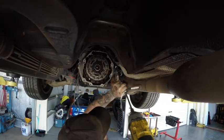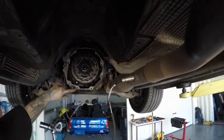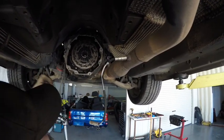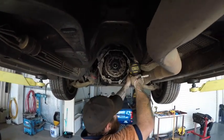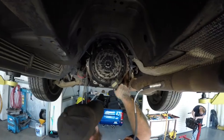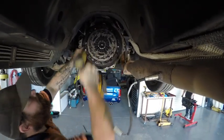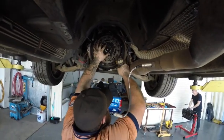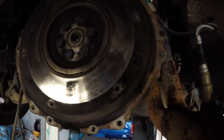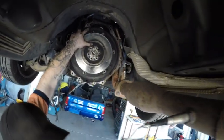We'll give this a clean and unbox the clutch and show you how to do a spigot bearing. With these - you've got six top bell housing bolts and then six 13s down the bottom - that'll come off. And then you've got your six flywheel bolts.